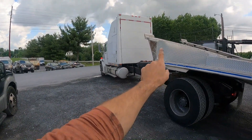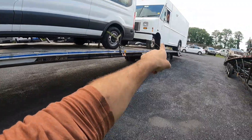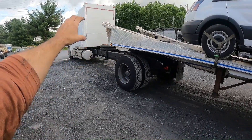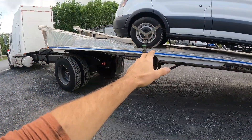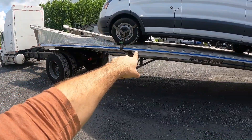When the wire leaves the light it goes into a fused junction box. I have one junction box here, one there, and one in the back. The wire goes from the plug in the front as one continuous wire all the way to the junction box — no interruptions, no cuts. That's important because fewer cuts means less chance of something going wrong.